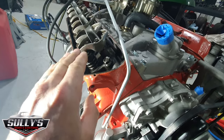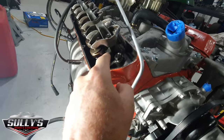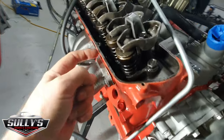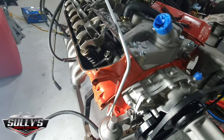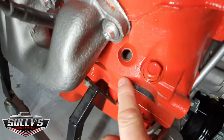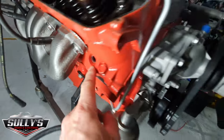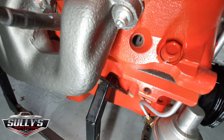And then as it closed, I knew it was on its compression stroke on the way up because it would have had a gut full of fuel, because you can see that's the runner there for your inlet, and your exhaust one is in line there with your exhaust port. So it's on its compression stroke. It's at top dead center. I've validated that by the piston. You can actually still see the number one written on that piston when I was assembling it.